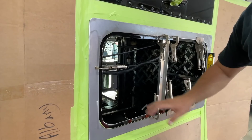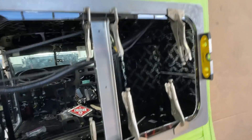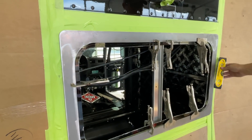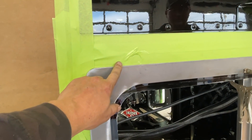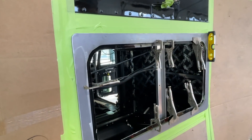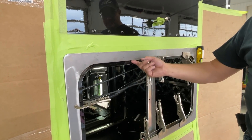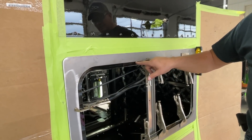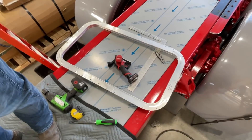All right. So our main hole is in there — you can stick your arm in. Look at that. So we leveled our piece up here and we've got exactly where we want our hole for the window. We measured from here to here all the way around — everything is where it's supposed to be. We've checked it 19 times. We're going to cut it once. I like to cut three times, measure once, and still be too short. So now we're going to cut right here. We'll use this aluminum template on the quarter plate steel. You can just kind of run your cutting wheel right around it and before you know it we'll have the rest of this out of here.